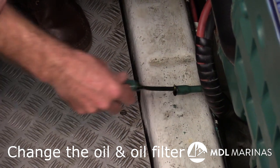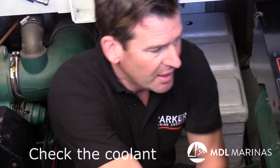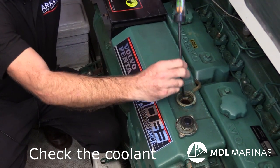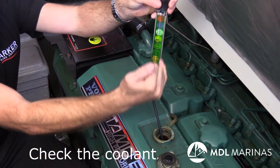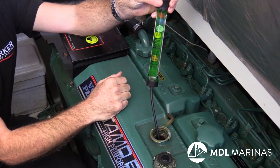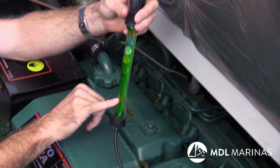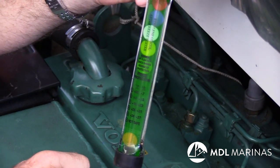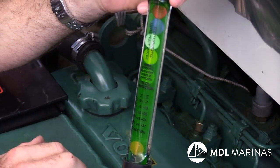The other thing I'll do is check the coolant concentration. We can use an antifreeze tester — we simply take the cap off the cooling system, suck antifreeze into it, and depending on how many discs float, it tells us the concentration. This is indicating, because we've got five floating discs, that we're good for minus 34 degrees Fahrenheit or minus 37 degrees centigrade — a really good concentration. We can also see the coolant is nice and clear, so we can be confident it's not going to freeze over the winter.